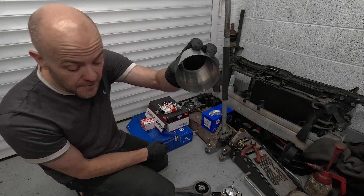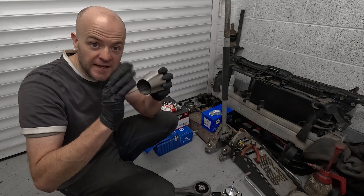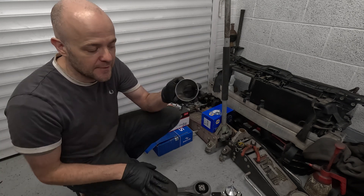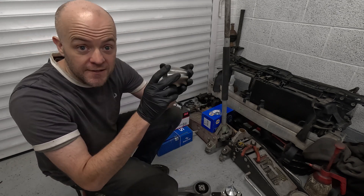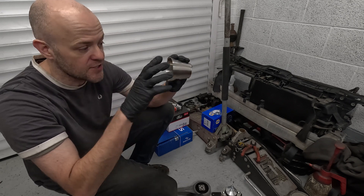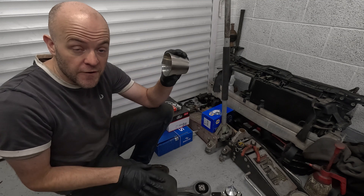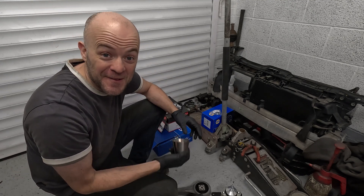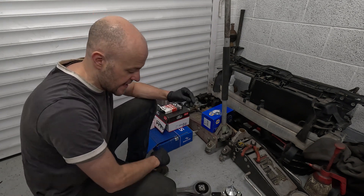That stainless is going to be for my turbo downpipe. The turbo flange is 51mm on the hybrid turbo - basically any of these PD ones is pretty much the same size. That's going to be welded into a new stainless flange I'm waiting on, and then that gets me straight into three inch. I'm going to do a full downpipe section all the way through, and there's going to be something that resembles a DPF on there, but I can't say much more about that.